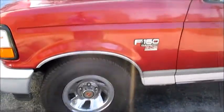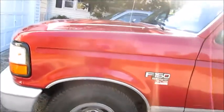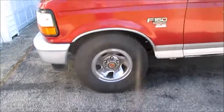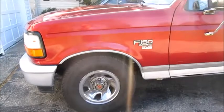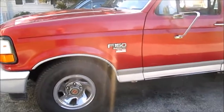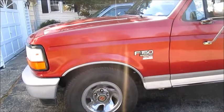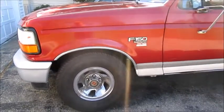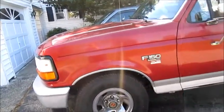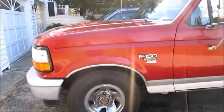And then what we're also going to be doing with this truck is we're going to be installing F-150 coil springs up front, level it out, stiffen up the ride a little bit. We're also going to have to replace our coil spring perches because they are getting pretty rotted. They're factory originals. Now how I know that is that they're still riveted onto the frame. So however, this is pretty easy. Just grind the heads off or drill them and then just punch them out. And the new shock mounts actually come with hardware, so that'll be good.